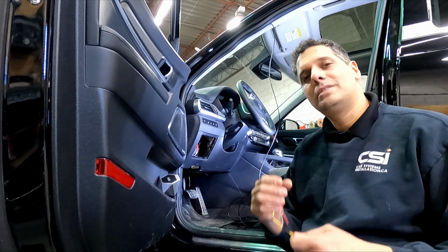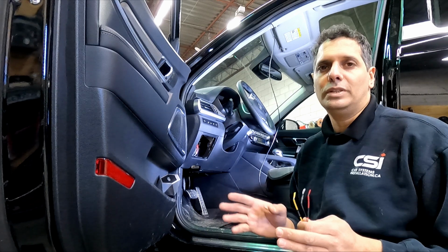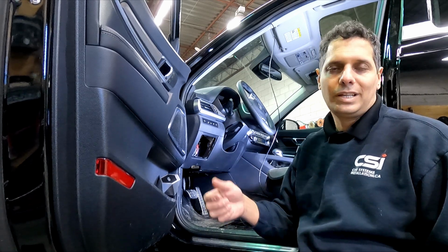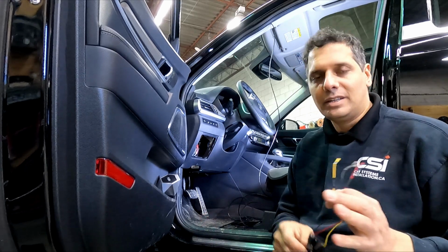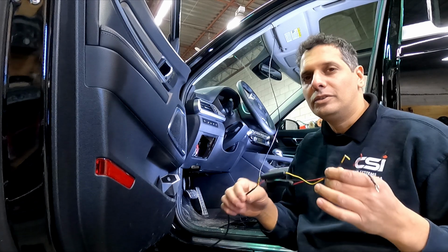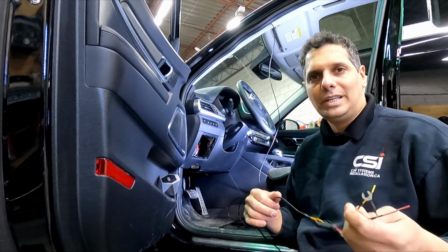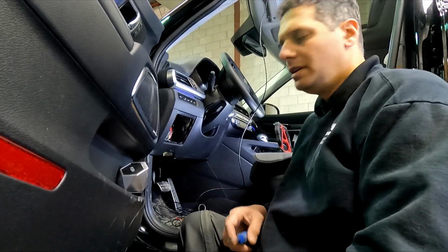Now, for dash cams, if it's a vehicle where it is difficult to find accessory and you found a full ignition, which means when you crank the power stays on, it doesn't shut down, that's perfectly fine. This camera only has about 2 or 3 amp draw, not gonna interfere with anything, not gonna cause any problem with starting the vehicle.